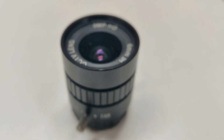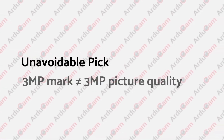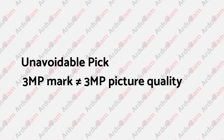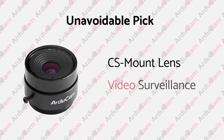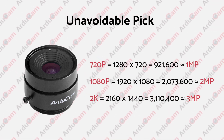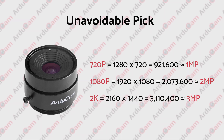The officially recommended CS mount lens has a 3MP mark on the top, which is a controversial pick that annoys many customers. However, that is an unavoidable concession for the balance, and that mark will not limit your 12-megapixel camera to 3-megapixel picture quality. The CS mount lens is mainly used in security cameras for video surveillance, which is usually in 720p, 1080p, or 2K. So here is some simple math: 3MP means it's capable of handling 2K video recording, which is pretty decent.